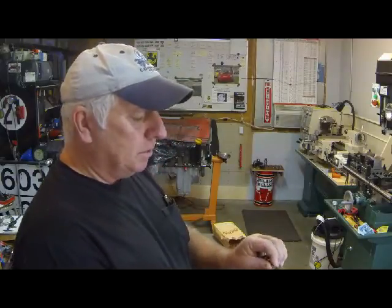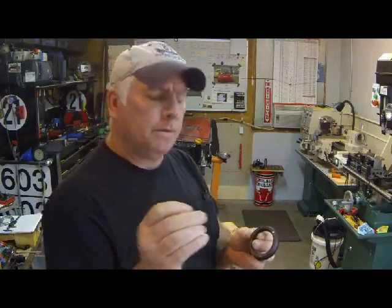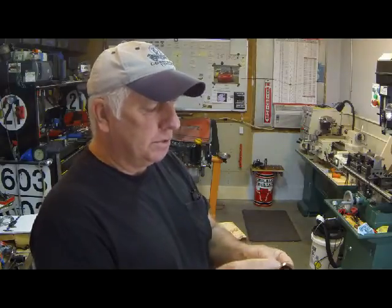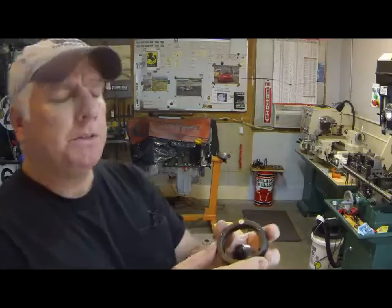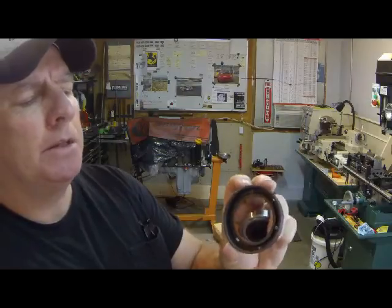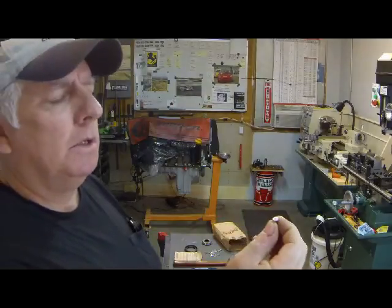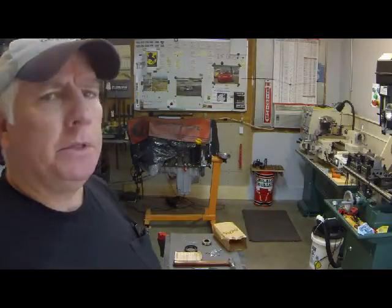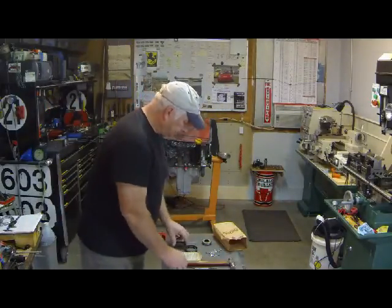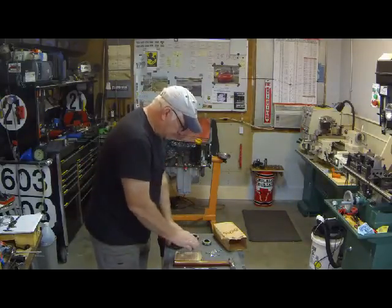A couple of things we're challenged with now: we've got about the right diameter of rivet for these pieces, but we'll need to trim the fit so that the rivet will fit inside this groove. It may be difficult to see here. To do that, we've got to machine the head a little narrower on either side so it will slip into this little stamped collar. So, let's just go through this and see how this is going to work out.